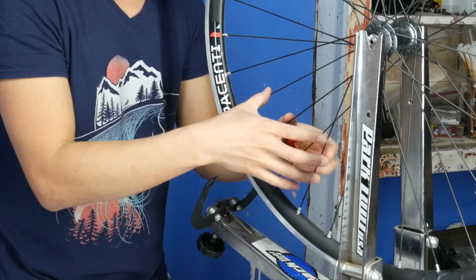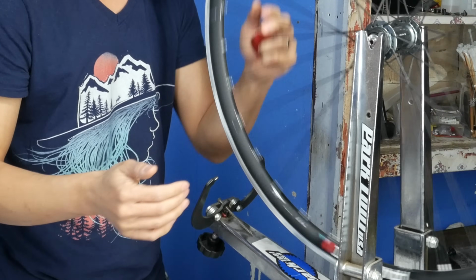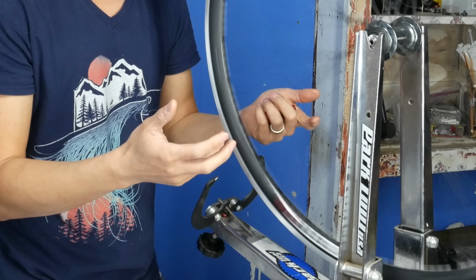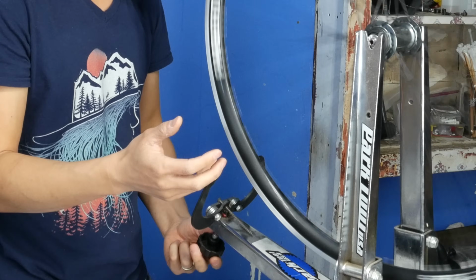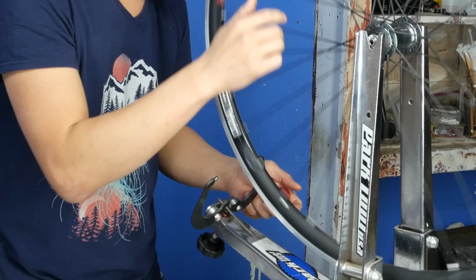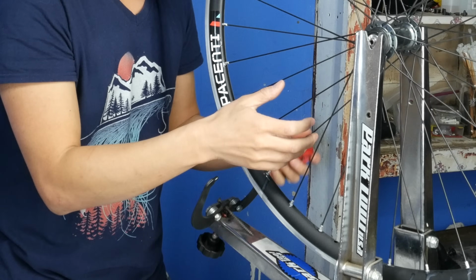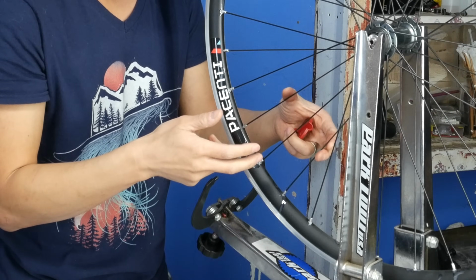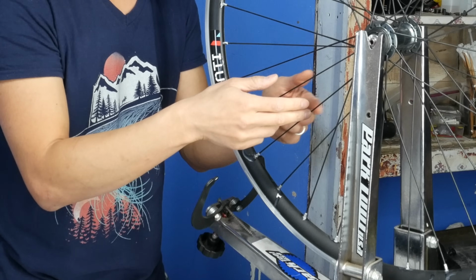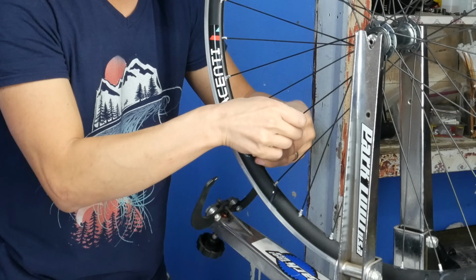And I'm tightening the spokes on the right side of the wheel, or my right, because I want to bring the hub to the left side of the wheel. And that tiny little scratch again, you can barely hear it. There we go. So that's another high spot. And it only spans 3 spokes, but the highest point is on the opposite side and on the side that I actually want to tighten. So that's the right side, which I'll tighten.